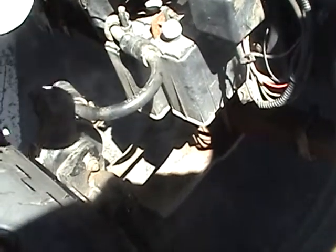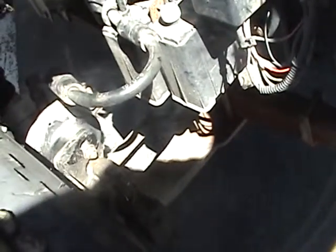My brakes, my air hoses going to my brakes look good. Again, checking my slack adjuster, which is right here. It looks good. All the components are there. Checking the inside of my tire for any bubbles, cracks. Looks good. Again, checking the inside of my tire for any excess grease coming out of the brake system.